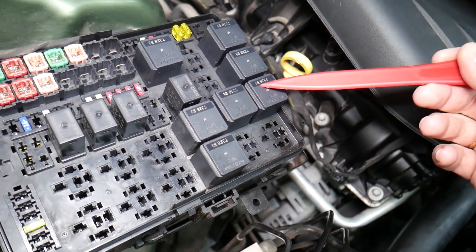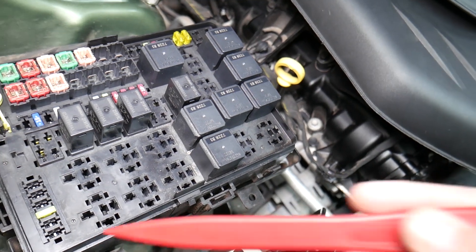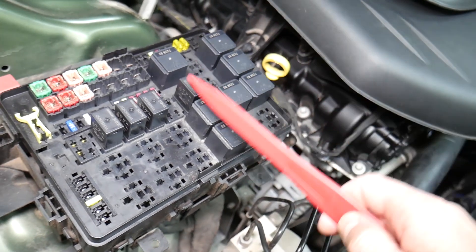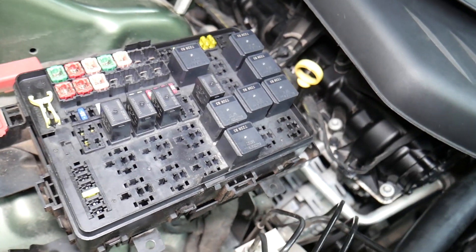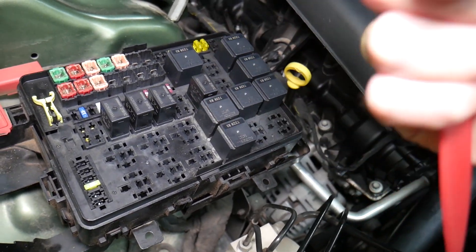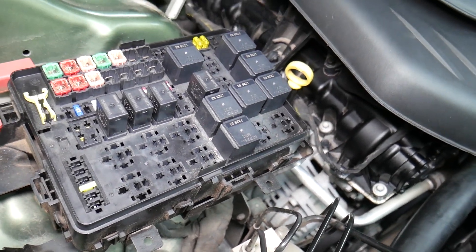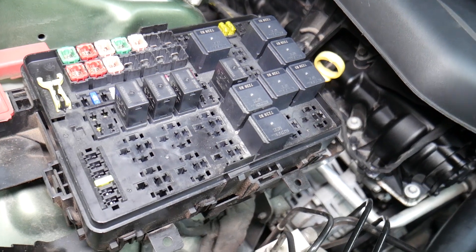The same thing for relays — some of those could be really expensive on cars. We'll put a link in the description below on how to test relays. For some certain fuses, it's important to disconnect the car battery when removing them, otherwise you can burn the electronics. For instance, when working on airbags, fuses, or anything like that, you need to wait at least one hour after disconnecting the car battery. If you're not qualified and certified to work on an airbag system, I will never recommend doing that. Also, when disconnecting the car battery, it's important to know which battery terminal you disconnect and reconnect first — if you do it the wrong way, you can burn electronics modules. We actually burned a traction control module on a BMW that cost $2,000. We'll put a link in the description below on which battery terminal to disconnect first.